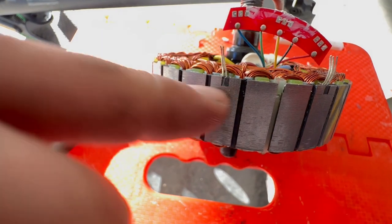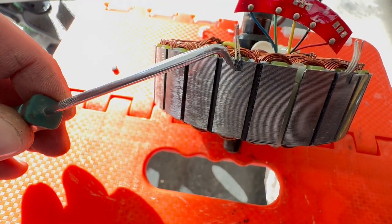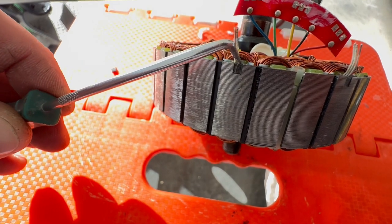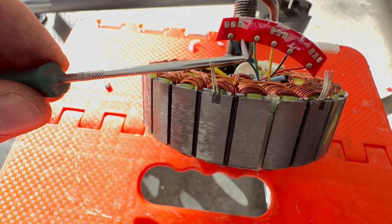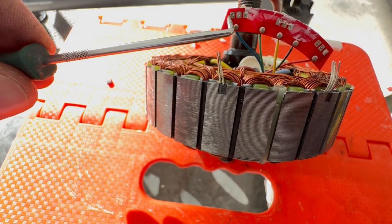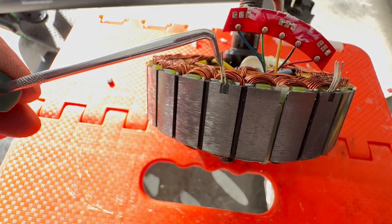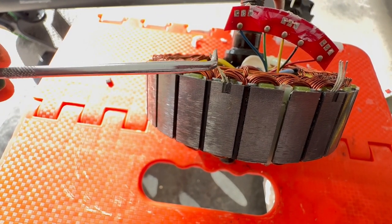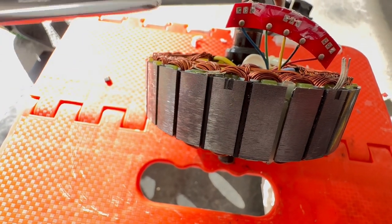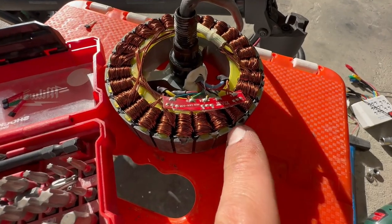The left and the right sensors are a little bit difficult. Maybe you have to break them out, and after that clean the groove very well, so the new sensor can slide in very easily. You have to clean the solder and open the holes so the new sensor legs go in very easily. This one will break any moment. Now, after removing the sensors, we clean the grooves.